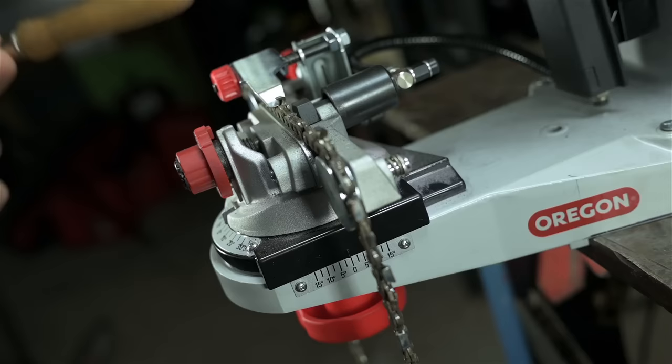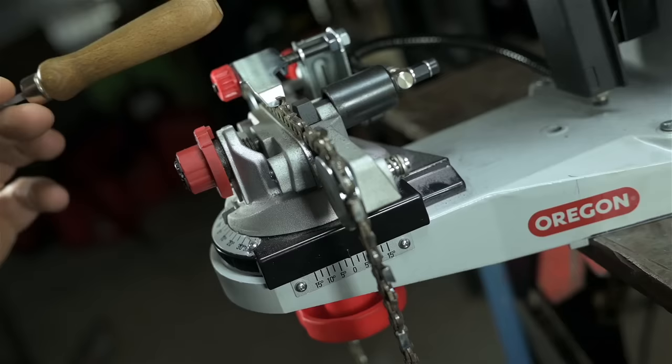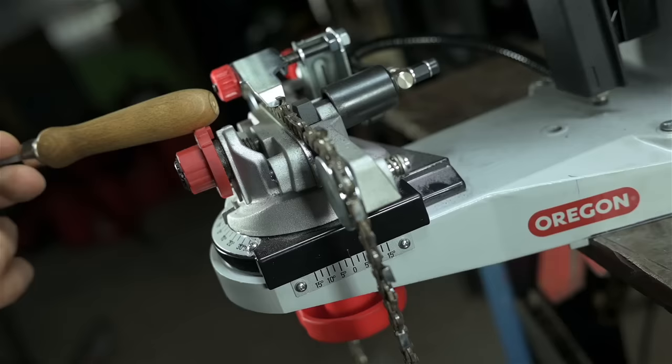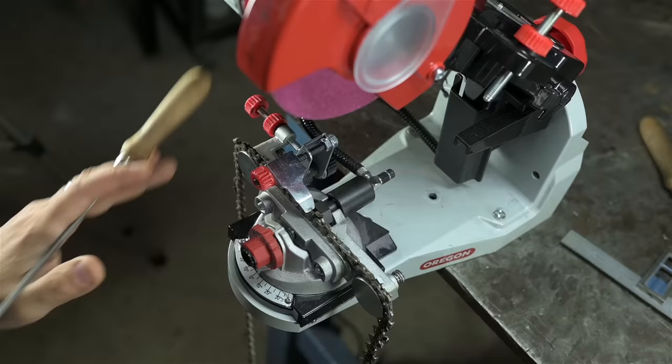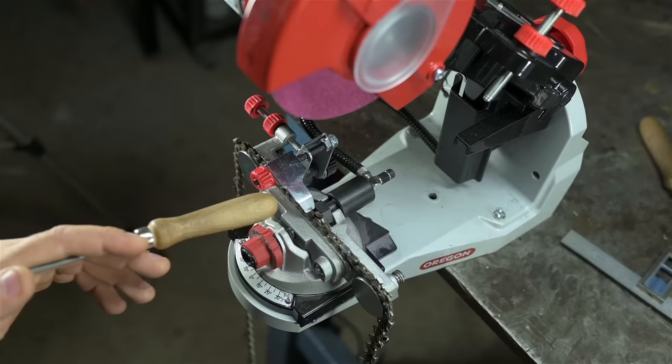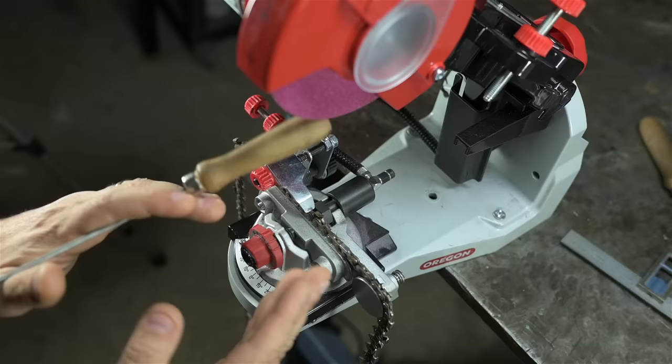Again, the specific angles aren't necessarily important, unless you're grinding a chain for somebody else maybe. But the key here is consistency. You might be a degree or so off according to the manufacturer, but at least all of the cutters will be the same. Sharp and the same. Granted, this just might be new guy talking here. But I think, even if you know your chain and you manage to look up your angles, I'd suggest keeping a really close eye on that first grind when you're setting this up for the entire chain. When you make 3 or 4 angle combinations, like you're tipping the head, rotating the vise, pulling it forward, you're getting into compound angle territory.